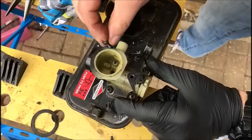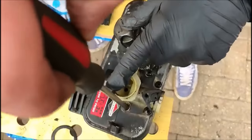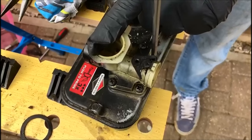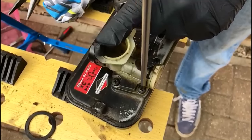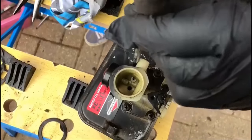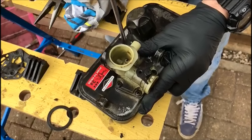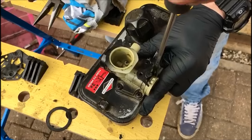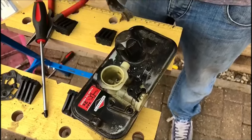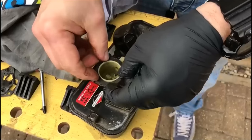It's not expensive but it's a pain having to wait for them to be delivered. The screws are in, and then like I said earlier we do this like a car wheel going diagonals — all that happens is it just makes sure that we're going on evenly. There's your diaphragm and your gasket on, and then you've got this little gasket that goes on top with a filter.